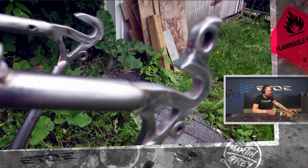The dropouts — I can see some red, George, there's an area you had to sand down. But that's okay for this frame. If you use spray cans, shake them well to mix the color inside the can — that's very important. I will link the stuff George uses in the video description. What I recommend for a high quality paint job is a two-component system. It costs much more — maybe three to four times a normal spray can — but it's much more durable. Buy yourself a two-component primer: it prevents your steel frame perfectly from rusting and gives an absolutely hard surface. You can use a one-component system — it's fine, but the quality and durability are not as good. Find both in the video description.